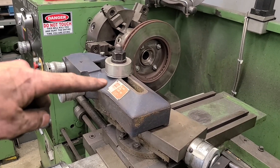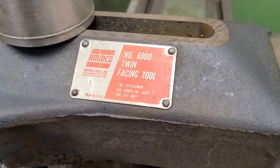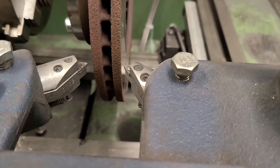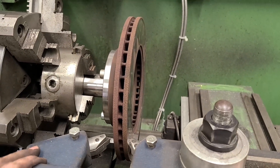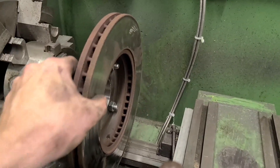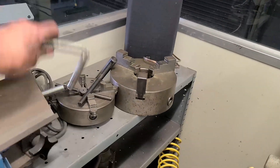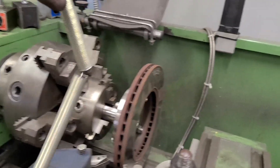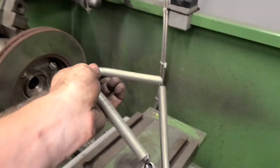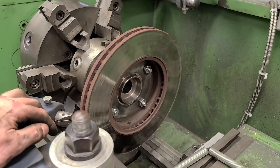So I took off the quick-change tool post, and there's my secret weapon — a little eBay purchase off an old Amco brake lathe. The 6900 twin-facing tool. Old school — it's got little carbides in it. With this setup, I can cut both faces in one shot, which means much less chance of any non-parallelism between the two faces, and I think it does a much nicer job. I've also got some anti-vibration tools to go around. They work okay, though I think they've moved to something else nowadays — some kind of pad that lays on here with pressure above the cutting surfaces.